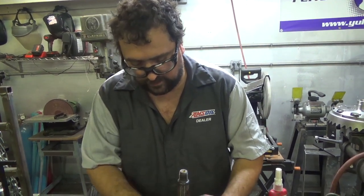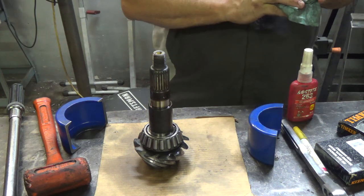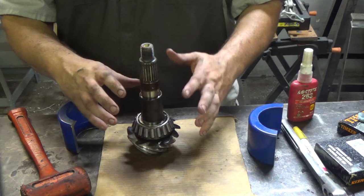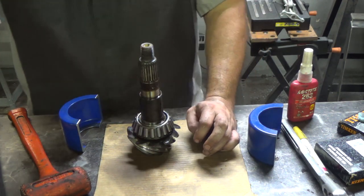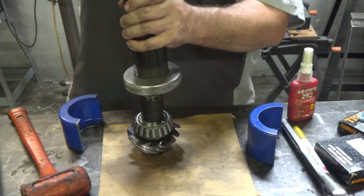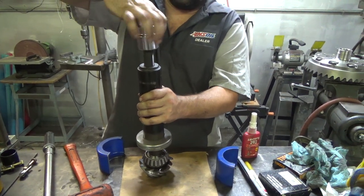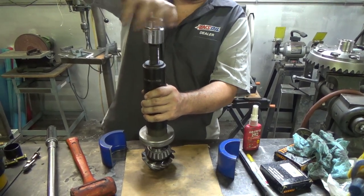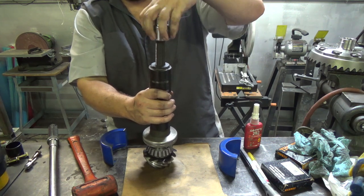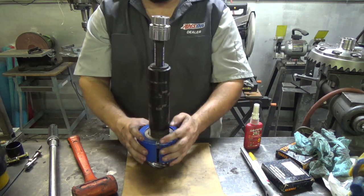It basically saves us the trouble of figuring that out in another way. If you were to go buy a couple of gear install manuals or spend a lot of time reading OEM gear installation procedures, they all have a mathematical plan for determining pinion depth. This is a bit of a potential gray area from shop to shop — how they want to determine pinion depth. What I do that seems to work for me is copy the old pinion depth, put the gears in, take a look at what those results were, and go from there, especially in this case where it was a manufacturer-installed setup.